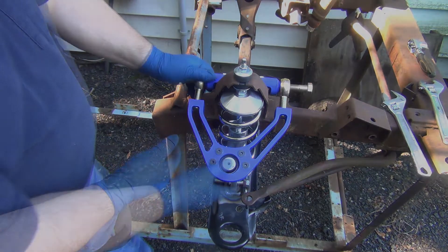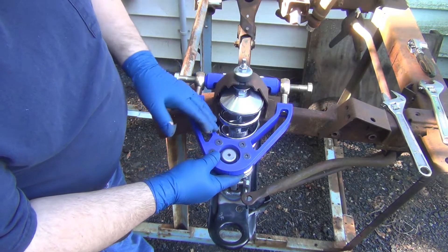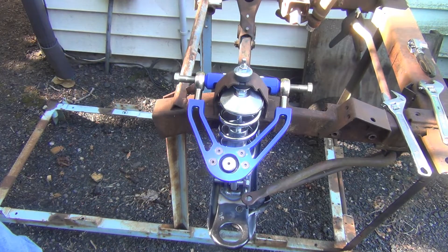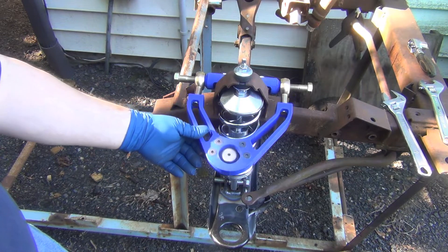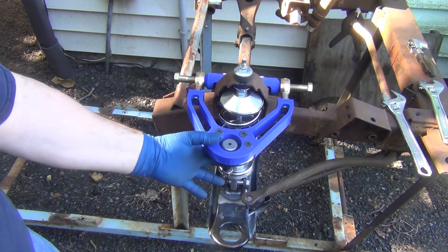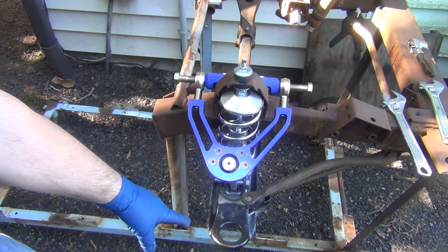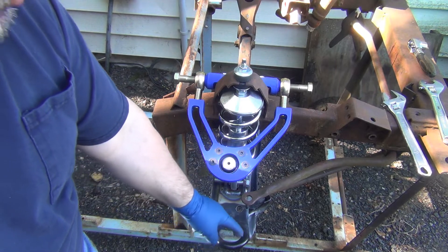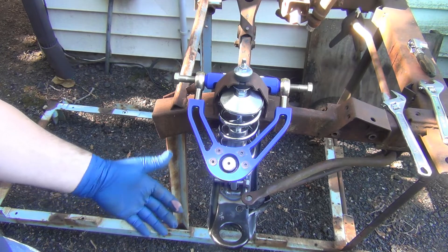I'm really pleased to see the clearance — that means I don't have to mess with changes to this shape or lengthening. No problem whatsoever. I should look and see what I have for spindle mock-ups. I could 3D print enough of the spindle to handle the ball joint mounts. Maybe what I should do is 3D print a ball joint for the bottom that I can put in and out, or I could just take an old ball joint, turn down the body so it comes up in here easily — that way I don't have to press it in and press it out.